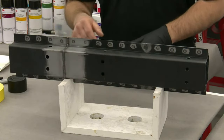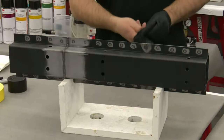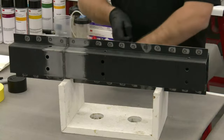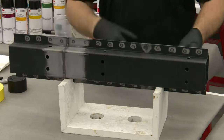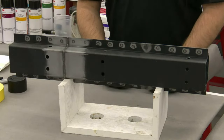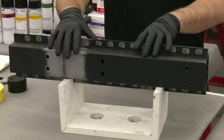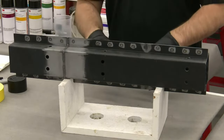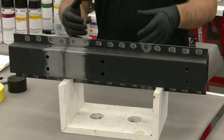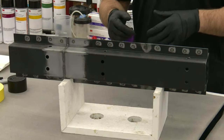delivering the vehicle. Cavity wax needs to be applied during the reassembly process, right? Before we wash the vehicle, before we're going to deliver it. Don't hammer it in there after it's been washed and right before you deliver it. We need to make sure that we're really getting the protection in there on all these, not only repaired areas, but replacement panels, paintless dent repair work, anywhere. And some OEMs will describe it as anywhere that the e-coat has been disrupted, right?